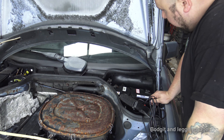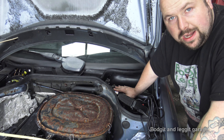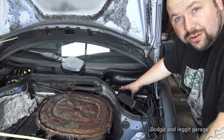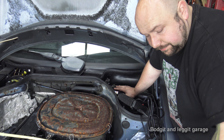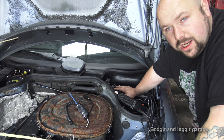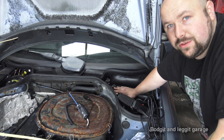Before you do this test, you need to make sure your battery and charging system is good. If your battery is bad it's going to drain overnight anyway, and if there is a little bit of a drain and your battery isn't great, it's going to drain quicker. We need to make sure our charging system is good. I didn't show this in the first video - I wanted to show it in this one.